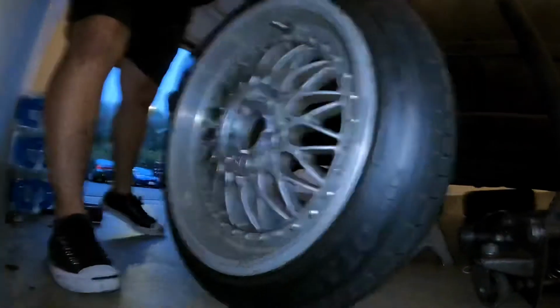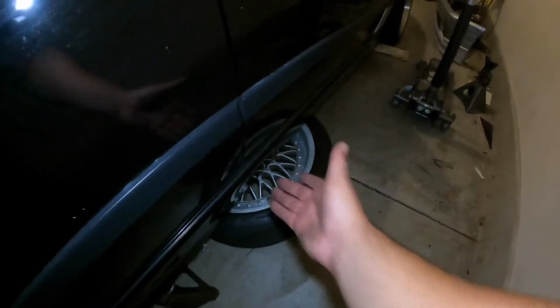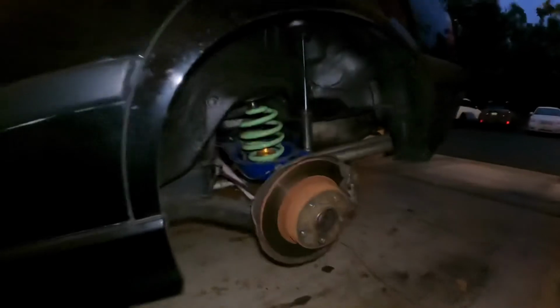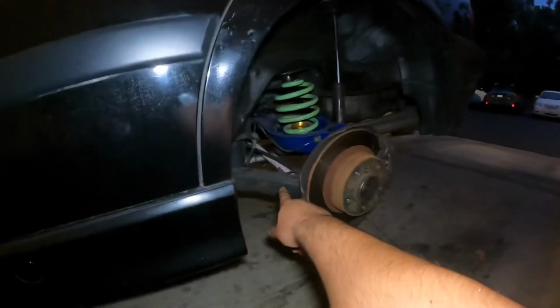No sleep. Just wanted to quickly throw this in there, guys. Just a quick safety tip. Once you take your wheels off, put them under the car, somewhere where the frame will be. So if the car does drop, if God forbid something happens to the stands, it will damage the wheel and not your legs.